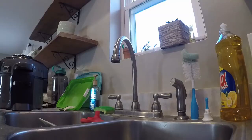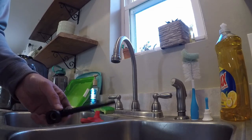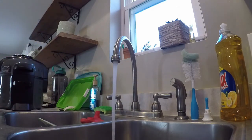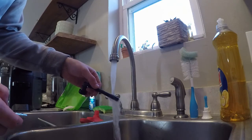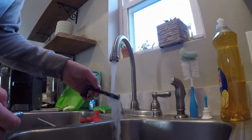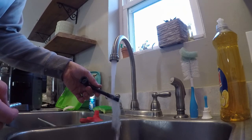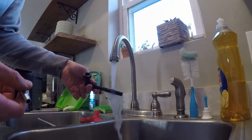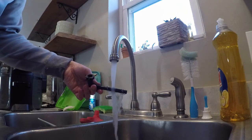If it doesn't work I'll let you know. So as you can see we're at the kitchen sink. I'm going to run some water, let it get warm, and warm this piece up — see if we get this to slip on this barb fitting. I'll leave this recording so you can see it in real time how long it takes to get it hot. Obviously under the truck we're going to do something different — we might have to warm some water up in the microwave and hold a cup up under there to dip the existing fuel line into it.